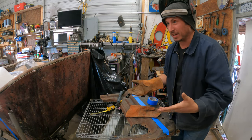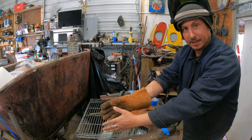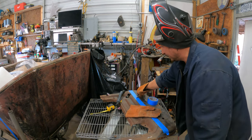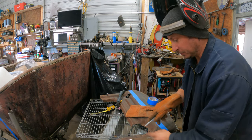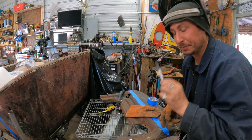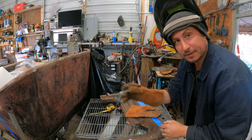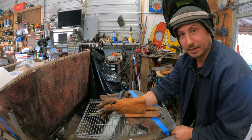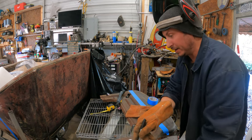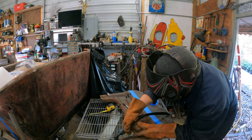One tip for cutting with anything like an exacto blade or really anything — sometimes if you have the option, it's best to cut in a straight line to or from you. It's good to be off to one side. If you're dragging a blade towards you, don't drag it directly into your guts — that's a good way to end up in the hospital. What I mean is, if you drag off to one side, that's your best bet because that's a straight line. As soon as I try to go across my body, I'm inherently making an arc. There's a lot more mechanism to make this straight as opposed to cutting across, because your arm is attached to you here.